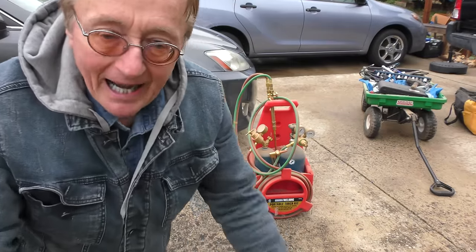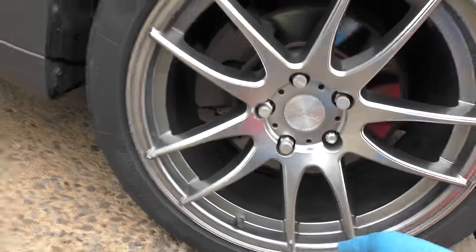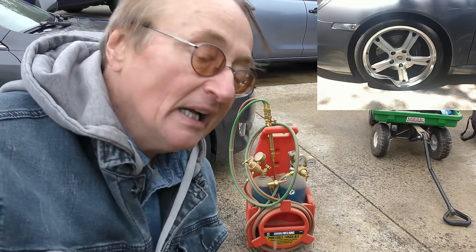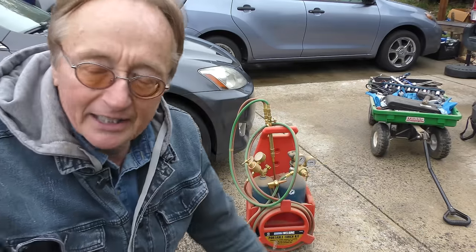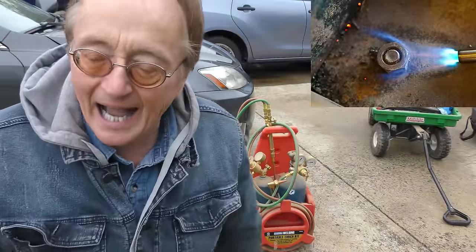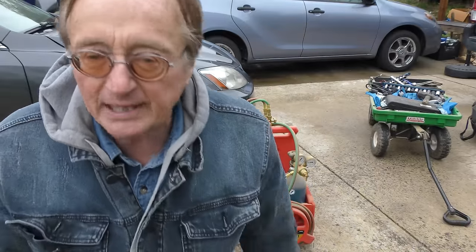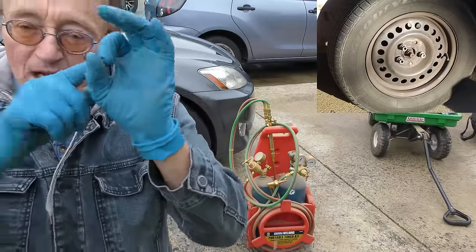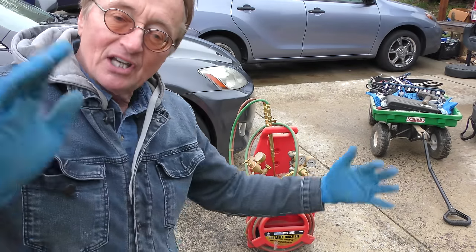Now that was a pretty easy job. I thought I was going to have to get my oxygen acetylene torch out — heat the lug nuts until they were glowing red, and then they'll come out like a hot knife going through butter. But a good thing we didn't, because on these fancy rims you'd probably end up warping and destroying the rims with that much heat. If you've got a junky old car with rusted steel wheels, you could heat them up until they glow red hot and they'll come right off. But in this case, just length did it.